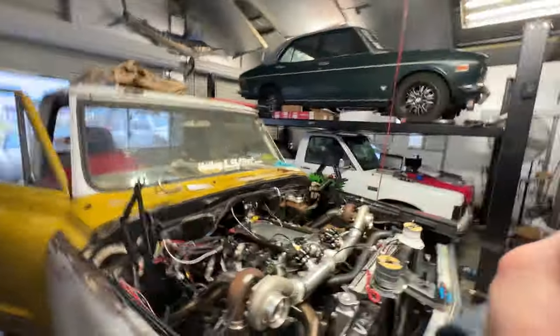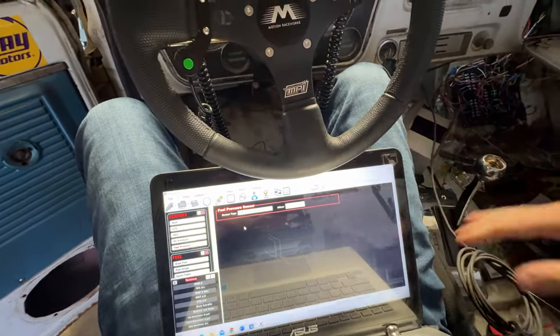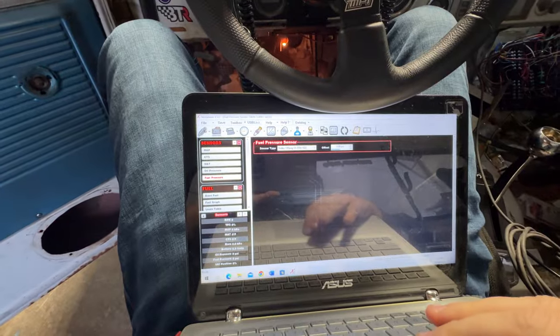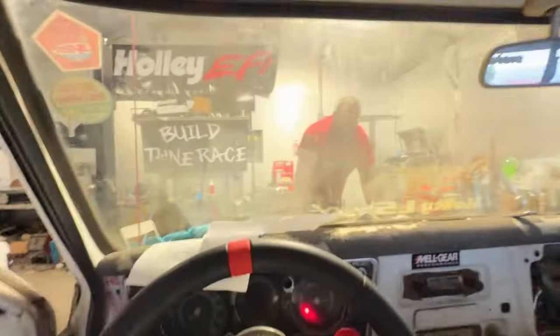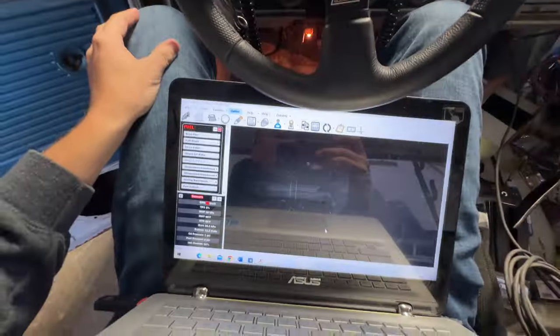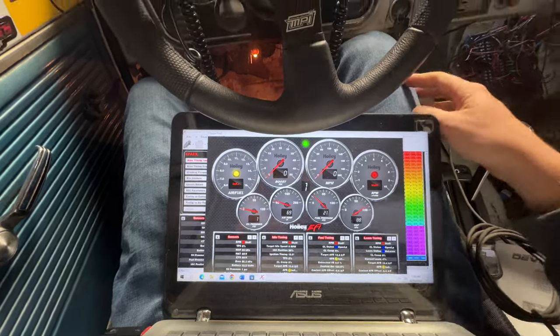AJ is finishing up wiring to the ECU, then we'll do some pinning and hopefully fire this thing up. Everything's pin-mapped — I think I've got everything situated with the ECU. We're keying on, getting fuel pressure, need to run the new tune into the ECU. We're checking for leaks — no leaks found, injectors look good, line connections look good, hoses look good. After using that brand new Snap-on multimeter we've got transbrake click and bump confirmed — found a little loose wire, got it figured out.